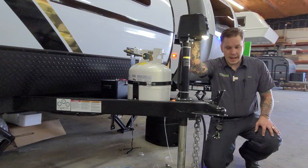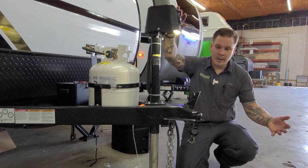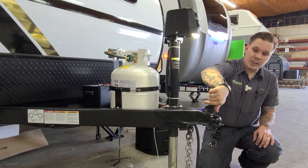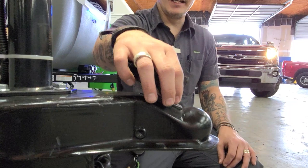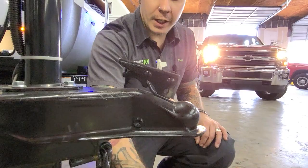As always, we're going to start right up front here with the loading and unloading procedure. This camper utilizes a two-inch ball hooked onto your receiver. Once we've done that, we're going to raise our jack three inches above our ball, back underneath, center ourselves underneath the coupler, lower that jack back down, seating that coupler fully on that ball. Once we are seated, we go ahead and fold that back, paying special attention that we do engage this secondary latch — that's going to keep things nice and secure. It's also recommended that you add a secondary pin here to keep anything from potentially rattling loose going down the road.